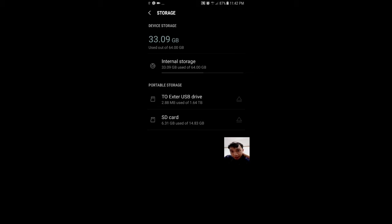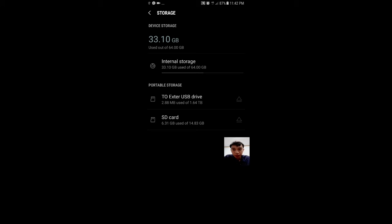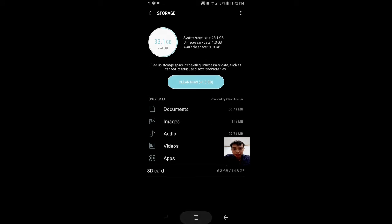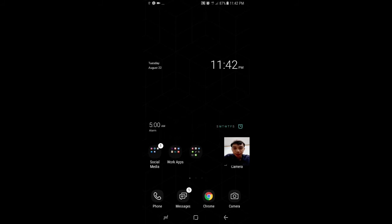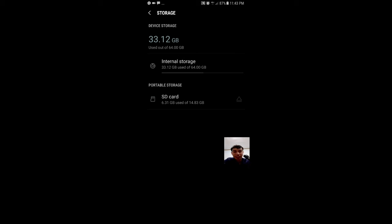But that's just to give you guys an idea. If you're looking to use an external hard drive for your Android devices, try to limit it to up to 2 terabytes, because I don't think Android is ready to read past that just yet. Nice try though — I say it was a pretty successful experiment nonetheless. External hard drives will work, computer 3.5 inch hard drives will work, but you're gonna wanna limit it to up to 2 terabytes only, and you're gonna need an enclosure that has its own power source. At least it's better than my 125 gig USB. Anyhow, I'll catch you guys in the next video — I really appreciate you guys watching.